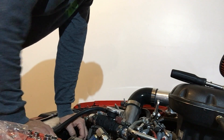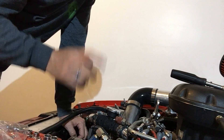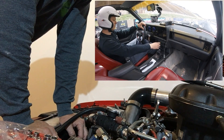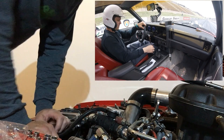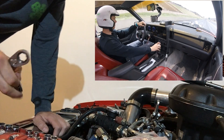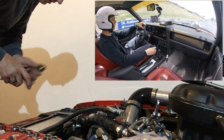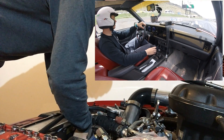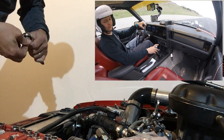A great example: the last time I went to the track, I made a lot of runs. I could not get my air intake temps down — the heat on the supercharger was so high that I basically had to stop running the car. I was getting over 260 degrees on the intake temps, which is crazy. I didn't want to hurt my engine, so I gave up trying to run it anymore.